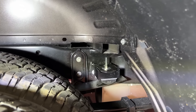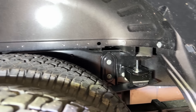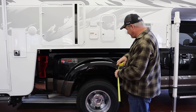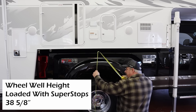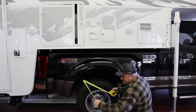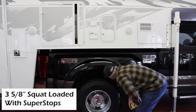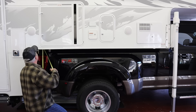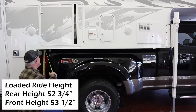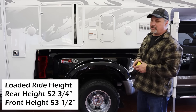Let's take a look at the springs. I'm sure those Super Stops are definitely helping, but it still squatted over three inches. All the legs are off the ground — let's measure the fender. It was going to be at 42 and a quarter, and now we're at 38 and five-eighths. So that's quite a bit — a little over, not quite three and a half inches. Now let's measure the front and back of the bed again: 52 and three-quarters at the back, and 53 and a half at the front. I have to look back and check what the original numbers were.